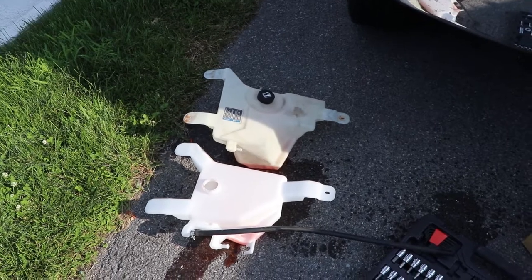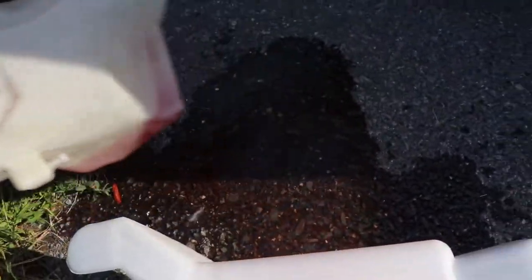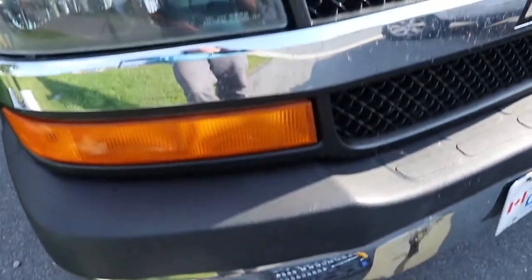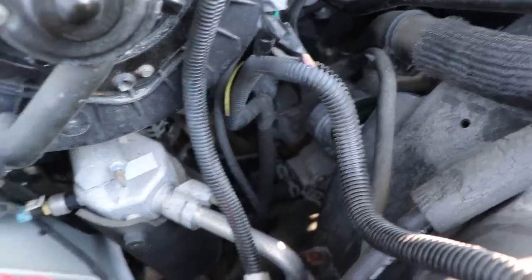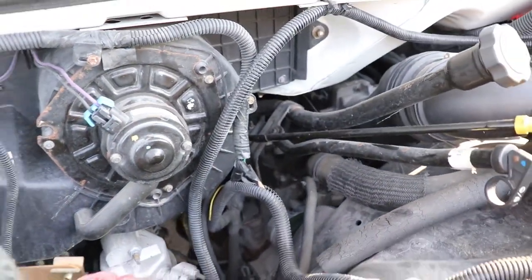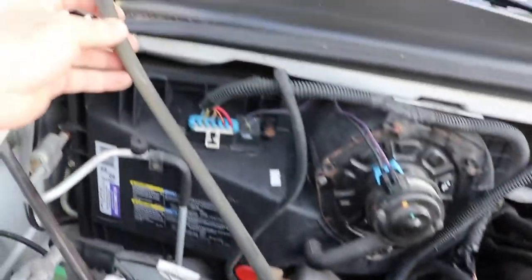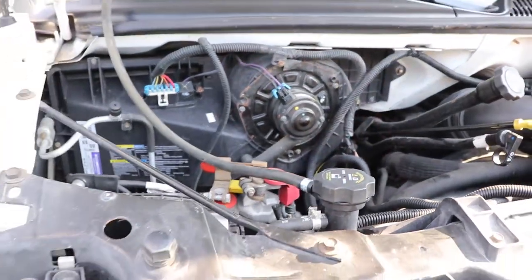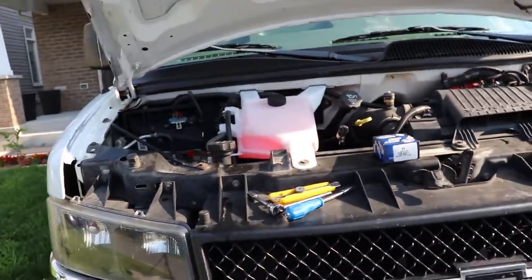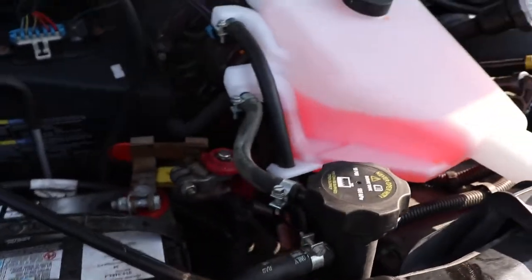You're not actually going to have much difference in coolant capacity. It's hard to stop it from dripping, but you'll have a bit more space to work in the engine bay — to reach down to the belts or the air conditioning, for example. That's the end result there. It's probably a good time to change your rad cap as well — just a 15 psi job.